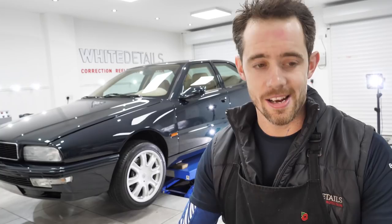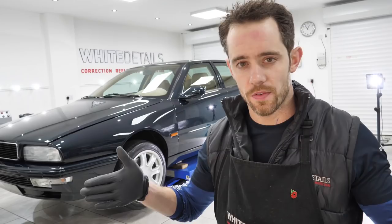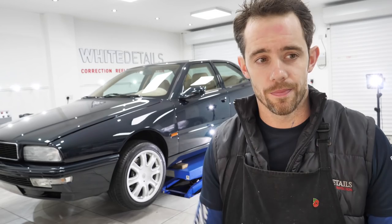Engine bay treatments, interior treatments, wheels off work, the full major paint correction. I'm going to say in terms of defects removed, possible defects to remove, 98.9%, 99% defect removal. It's had a bit of paint work. It's been interesting to match up what may have been done when the sides of the vehicle, with the near side rear wing as an exception, responded a lot different to the tops of the vehicle, so the bonnet, the roof, and the boot, very much different in the cutting and refining.